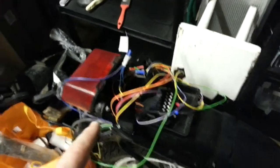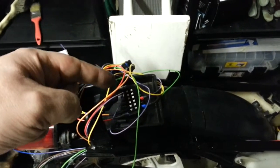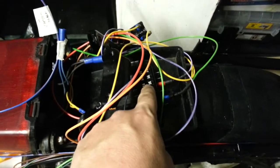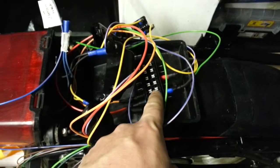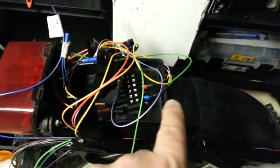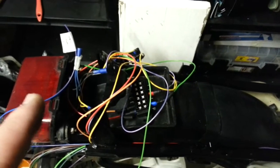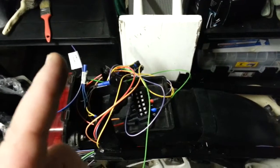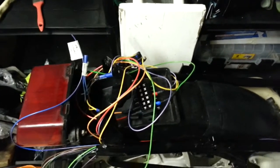Now what I have to do - because I'm adding a fuse box where there wasn't one before - I've got a certain number of fuses that I can use. So I've got the main loom coming in and going out there. This is the one for the headlights, the spare, and I've got the one for the indicator - so I've got three more. This one is going to be taken up by the tail light and the side light because they go together on the same circuit. At the moment I'm just getting my head around how to wire that one in, because that one never had a fuse either. So I've got to wire the tail light into the fuse box, run the length of cable up there and back down there to get the power. I'm still working it out - I shall take the wiring diagram to work with me and have another think about it.